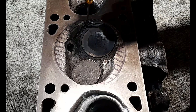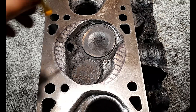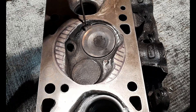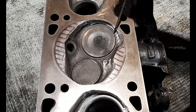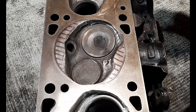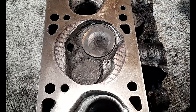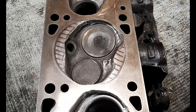My next question was: what about the next combustion chamber? Should I do a straight cut or should I lay it back and angle it? He said if he was doing this just for his own motor, he would do all the rest of the combustion chambers on the angle laid back. But if he was doing it for a customer — because he'd done one straight — he'd do them all the same, otherwise the customer would complain. He said because it's yours and you're not going to worry about it, do all the others laid back. It's up to you.